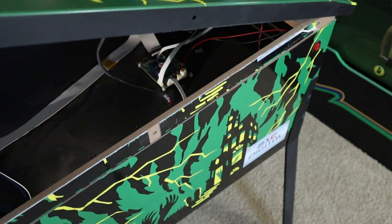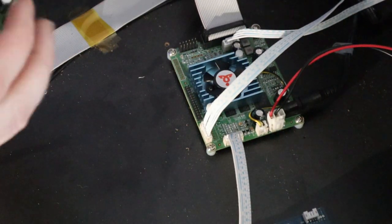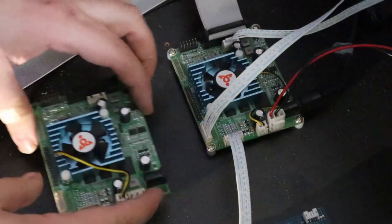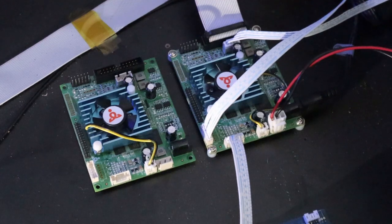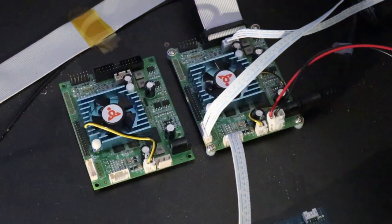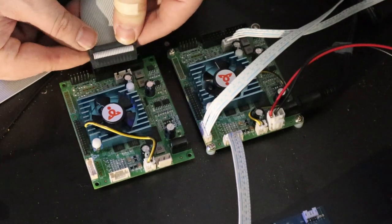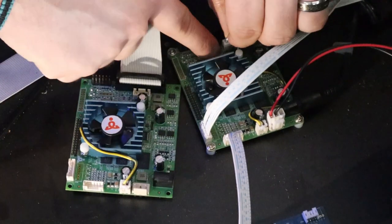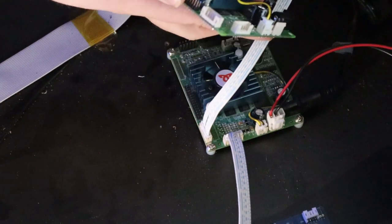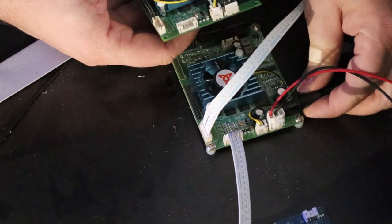Guys, this is important. Those wires are not very long — maybe a little over a foot long. If you just yank your monitor off, you're going to severely damage your cabinet. Okay, we are inside the pinball cabinet now. You'll see there's the original PCB board plugged in. Here's the replacement PCB board. My best suggestion is to line them up and position them in the exact same position, so you can easily unplug the wires from one port and plug them into the corresponding port on the new board. You have two options: just plug everything in and start reassembling, or do a clean, secure install — especially if you move your stuff around often.